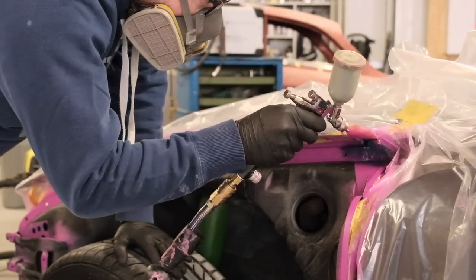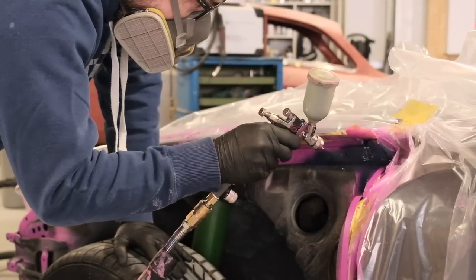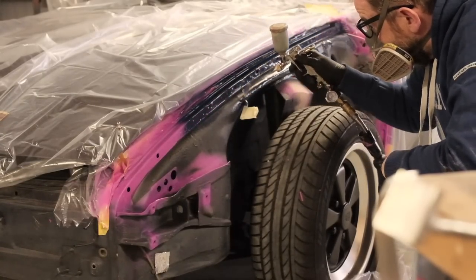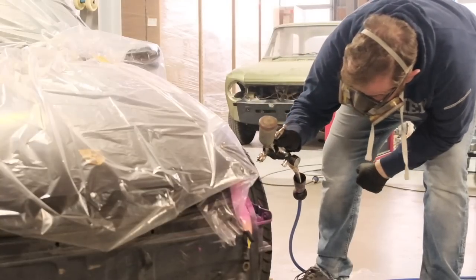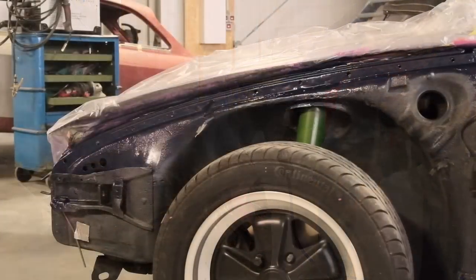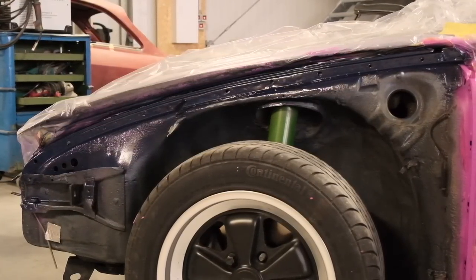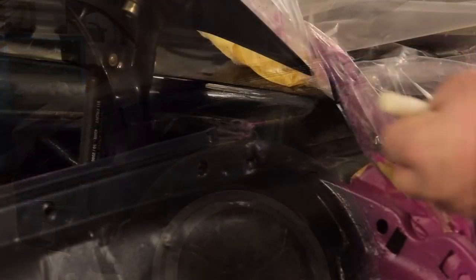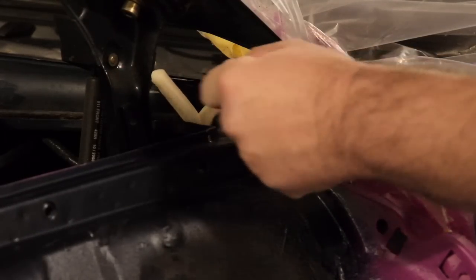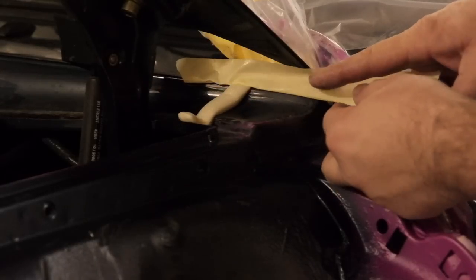Next, the actual base coat goes on. Though I actually do have a supply of acrylic paint, in this case only water-based paint was available. The wet water paint looks a bit like Neymar's new earring, but no worries — it dries down to a flat surface, and while that happens the shade of the color changes. At the transition area between old and new paint, some blending needs to be done, and that requires either a soft edge tape — the white foam one — or normal tape folded.